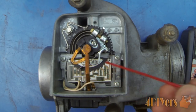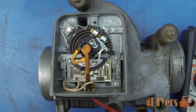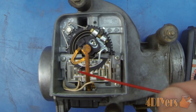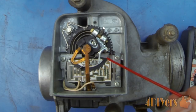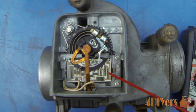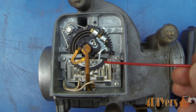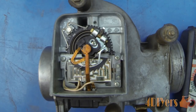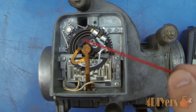The values may vary a little between my reading and yours, depending on how clean or dirty the contacts are, or the final voltage of the 9-volt battery. You will always notice a small drop — roughly 1.5 to 2 volts at the end — and that's perfectly normal because the electricity has to pass through several contacts, so there will always be a certain percentage of voltage drop.